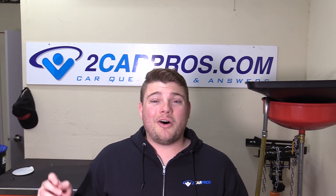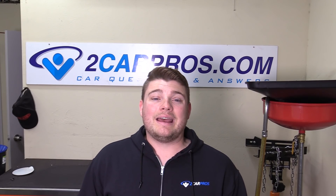That's how you change the oil for your 2005 Honda 1.3 liter hybrid. It's really easy and straightforward — you don't even have to put all that much oil in there; 3.4 quarts isn't a ton. All the applicable links down below in the description will help you out if you're confused about what filter or oil to get. Doing this repair yourself is going to save you hundreds of dollars now and thousands over the lifetime of your vehicle, and you know the job is being done correctly. If you enjoy this type of content, consider subscribing. Thank you so much for watching and I'll see you next time.